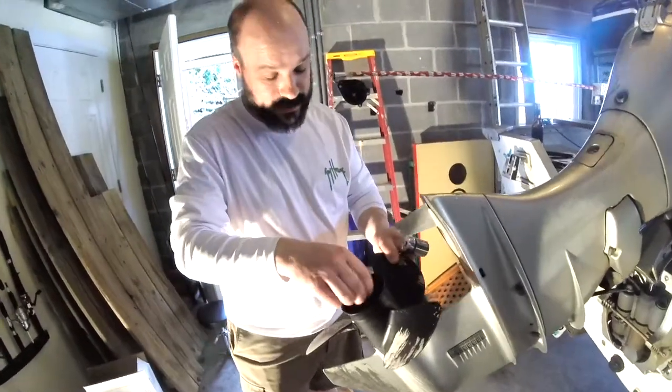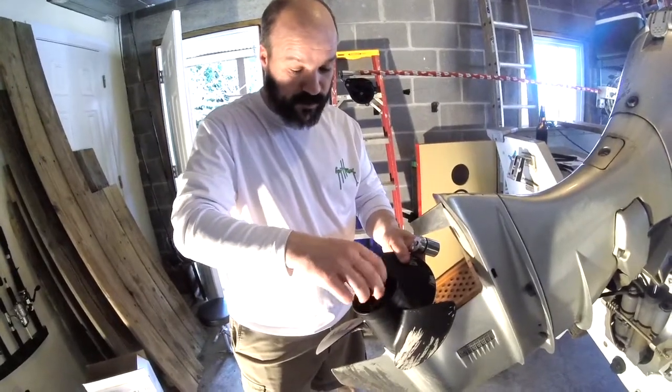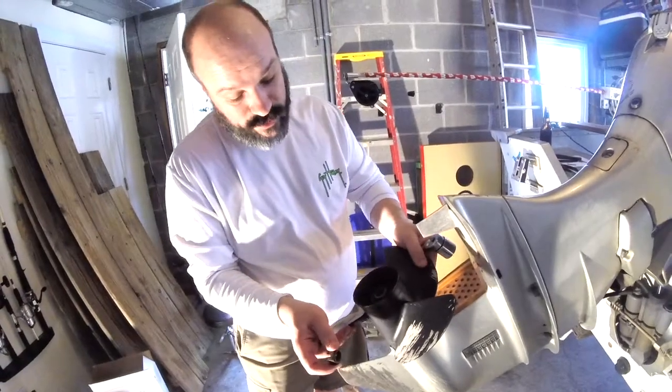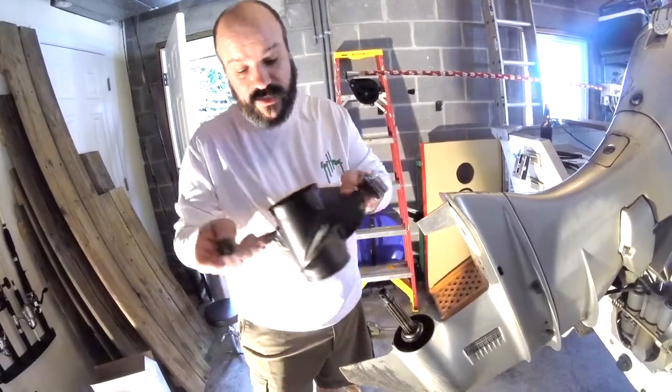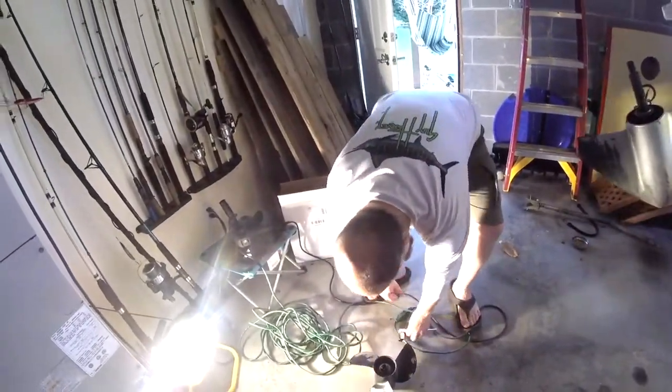Maybe a little too easy. Might need to... That cotter pin will protect it though from flying off. You want to have that, and then pull your prop out. There'll be a little washer there, but if you keep everything intact and just set it down real gently, you should be in good shape.